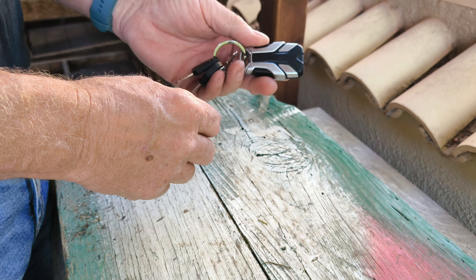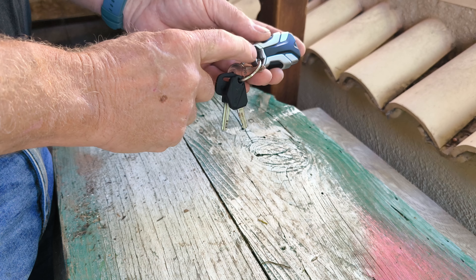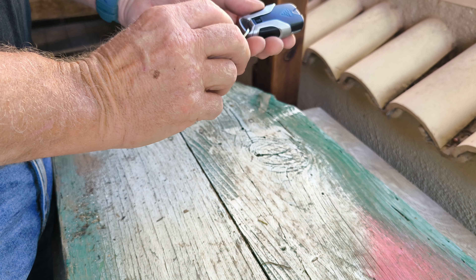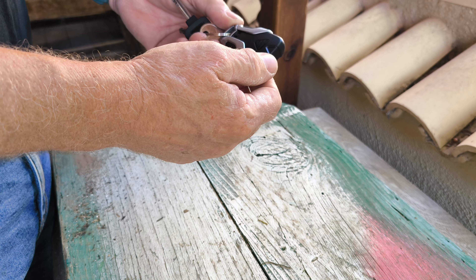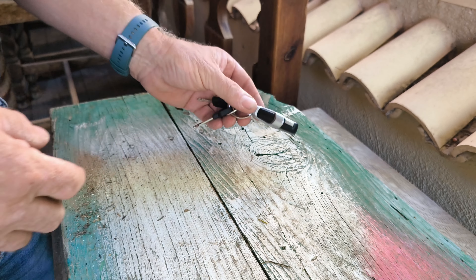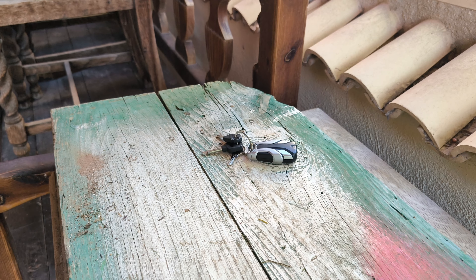It's advisable to carry a couple of these batteries with you, because the chances of carrying your spare key are low — I leave spare keys for all my vehicles at home. Another thing: for the Vos, like any other bike, the remote just sends out a transponder signal. You can get them cloned quite easily — most places do transponder keys now. It won't look the same, it'll be a different key fob, but it'll unlock your bike just the same. You could also get the fuel cap key cut as a clone and have the clone fob and the key separate.